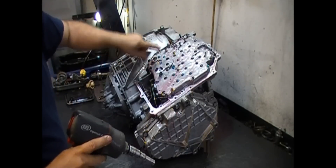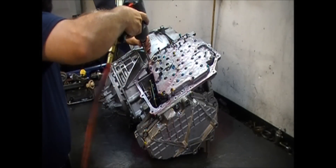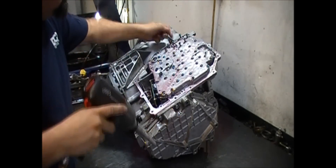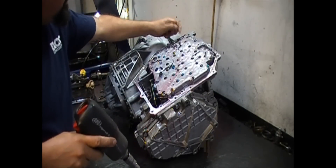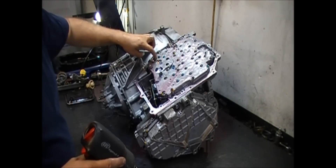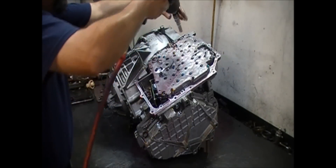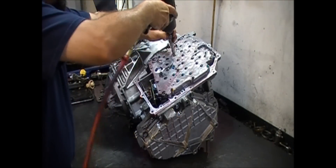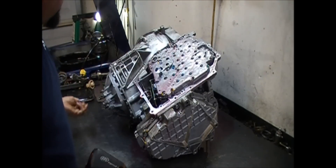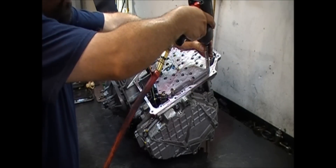I can see I'm already missing one of these brackets — it takes two brackets to hold the filter down in place. Depending on how the filter is flexing in there, I don't think it's creating an issue, but if the filter falls off and you have air going through the inlet hole then you can probably have a loss of prime. Whenever you get a loss of prime code or this bracket is missing, you also get something like a P0731 gear ratio error in first gear.